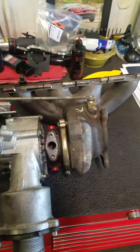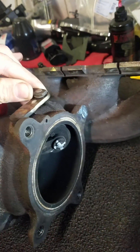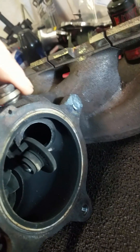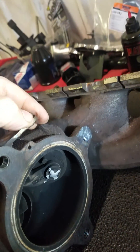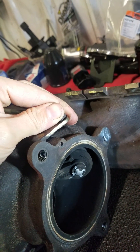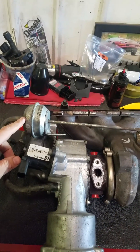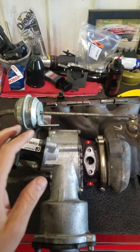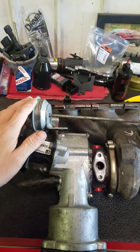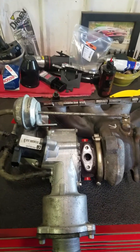So that's what I would look for — look for wobble or play in this bushing. And if you can, pull the exhaust back, open it, and look to see if it's leaking like that. Most of these that fail, you're going to find this play and wobble in the bushing of the housing. This one also had a bad actuator, which is not as common, but the bushing wear is super common for the failure. Once this is bad, you've got to replace everything.